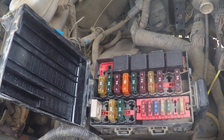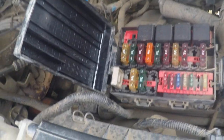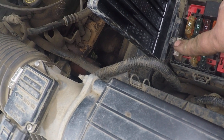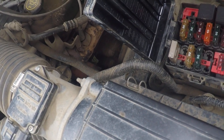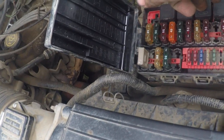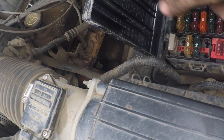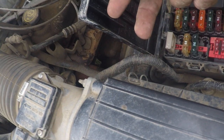We had a 12-volt supply for our load circuit. Over in the fuse box there is an ECM diode that supplies power to the ECM — if it's bad or not working, the ECM won't give proper voltage outputs. We pulled it out, checked it, it checked good, and put it back in. All of a sudden we had control on our relay, so obviously we had a bad connection on the diode. That was the cure to the third problem: a tripped inertia switch, a bad selector switch, and a bad connection on the ECM diode.